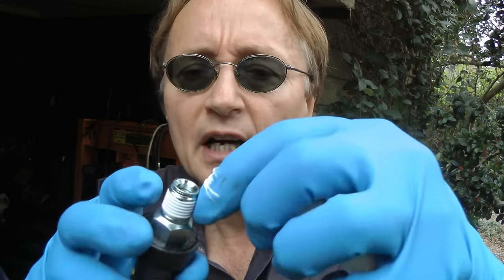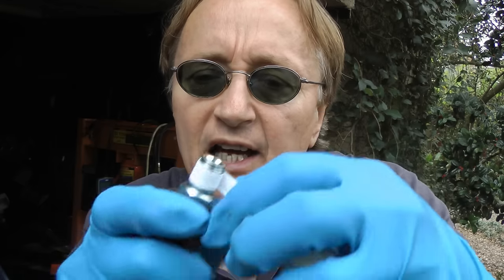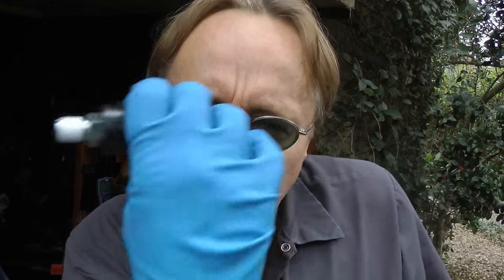Here's the stupid little switch that was causing all the problem. The plastic part just swells up over time and starts to leak power steering fluid. Here's a new switch. Now realize the power steering pump can put out 1600 psi, so wrap a little Teflon tape around the thread so it doesn't leak when you get it in tight.